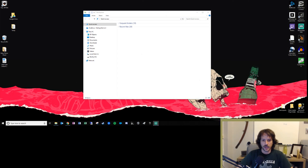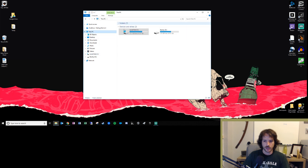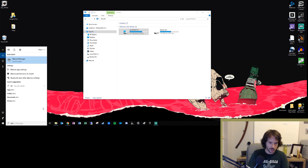So we got the computer back up. We've installed the adapter and put the M.2 drive in. I've started up my computer but I don't see the new drive pop up. I can see my local disc and my other disc, but I don't see the new 500 gigabyte disc I just added. So just to make sure everything's working, the first thing we'll do is go ahead to Device Manager.